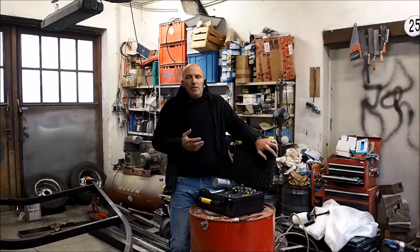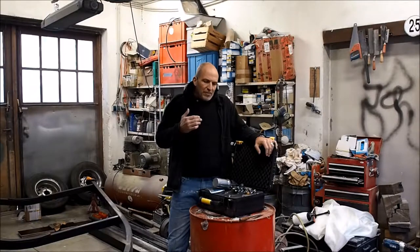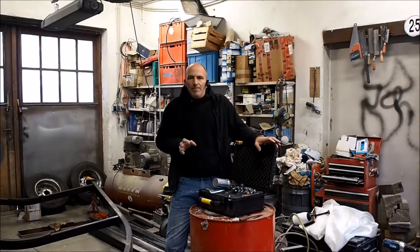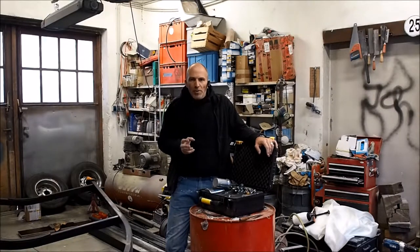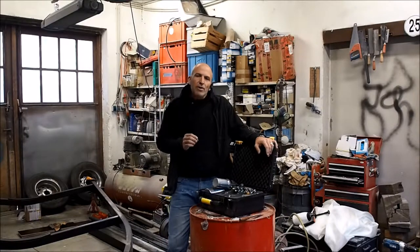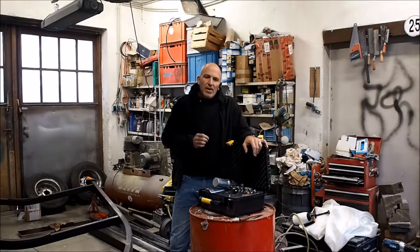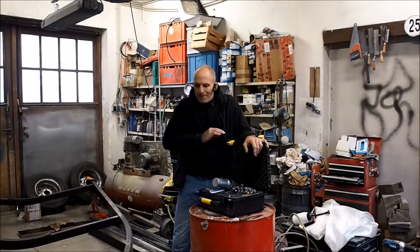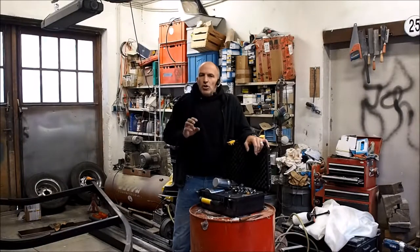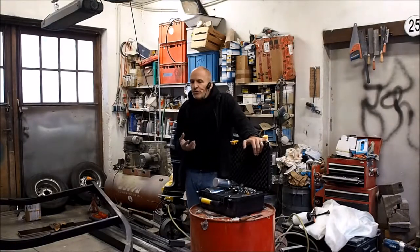All right, then the first thing you need is to put a base coat underneath your flakes. That base coat can be any color. On the original flake jobs, it's normally black. The problem is, if you, for example, do a gold metal flake job and you have a black base coat underneath, you will need tons of flakes to cover that and get a proper job where you don't see any black anymore. Obviously, you can use that as an effect, so there's no rule what to use. You can put any color underneath any flakes, so just try it.